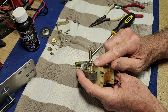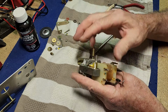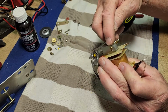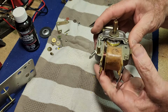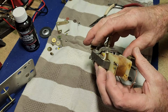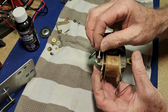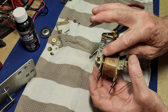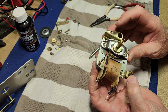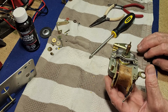I should be able to find another screw in my workshop, but we need to get it out of its keeper, so to speak. So what I'm going to do is rest this part of the motor on the anvil, and give it a sharp tap on top to jar the thread, and hopefully that will free up whatever's bound it up, and then we can get some pliers on it and get it out, because I don't want to have to try and re-tap the thread, and we can't really put the motor back together with only 2 screws in it. So I'll go and give it a tap on the anvil and see if we can free it up.